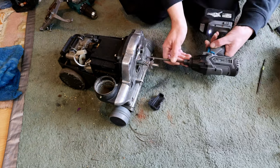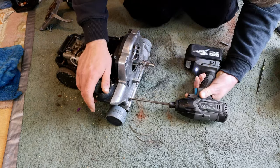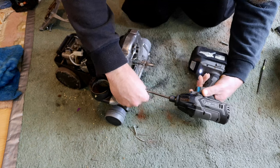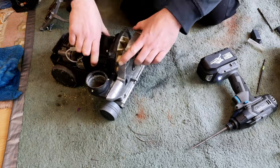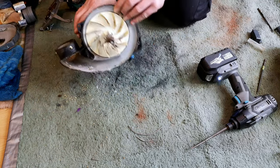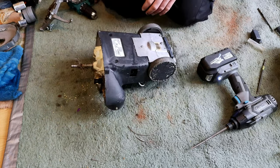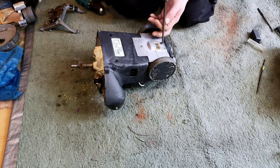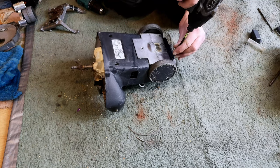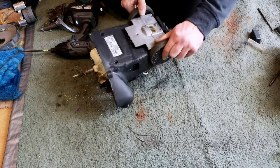I need to not break it the same way I broke the other one, which necessitated me having to get this disgusting thing at all. These are the screws which might cause problems. There we go, and then take the one out by the switch. We need to lock and take out the motor which is going to involve turning this thing upside down. We're going to take the tech drive out - it's not a clutch, it's a tech drive. I need to take the cam off the back of the motor with a cog so I can lock the belt spindle and take the belt off. This is roughly where I broke it last time - I just know not to hammer.